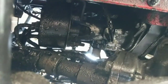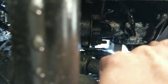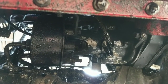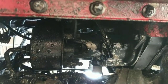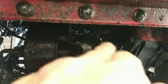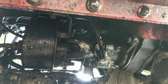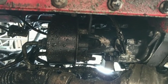The vacuum pump is up here underneath your steering box. It bolts up to the front of your gear cover and is gear-driven off the gears inside. Behind it is the power steering pump, so there's a shaft that goes straight through the vacuum pump and into the power steering pump. There are two ways to do this: you can remove the whole assembly by taking out your power steering lines — there are two bolts on the front cover — or the easier way, which I prefer.